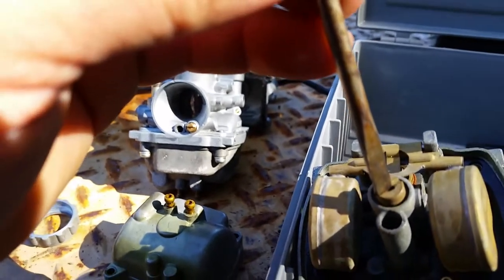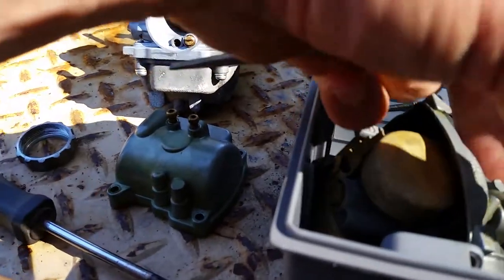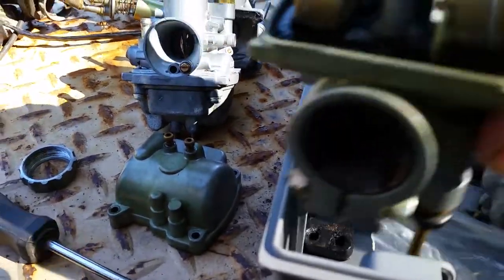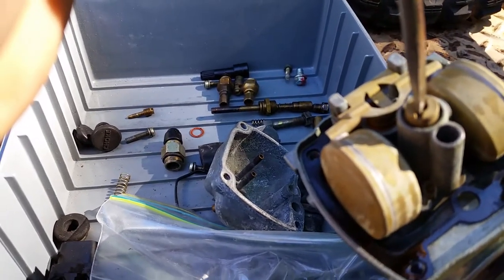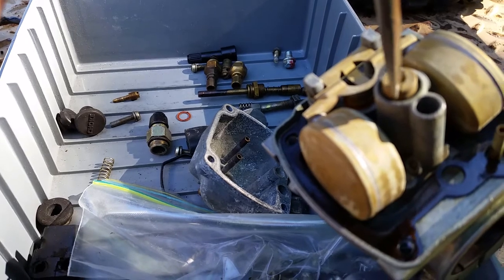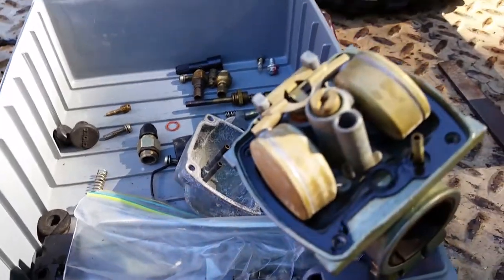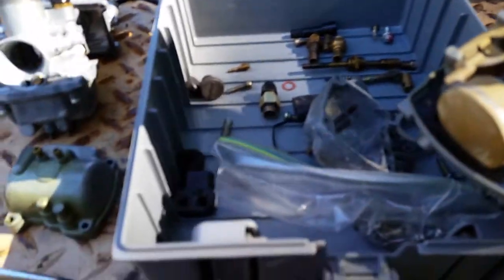See how this carburetor, the screwdriver does not fit this carburetor? Do not use it, you're gonna ruin that jet. Okay, you are going to absolutely ruin the jet. Why? Because this screwdriver fits in there too sloppy, does not fit all the way across, and is very, very loose. And that is what ruins the jets. And makes it harder to grab grip.